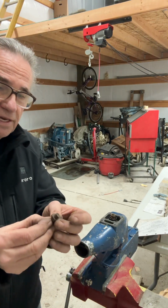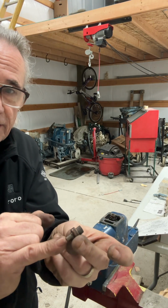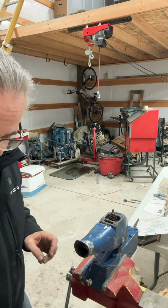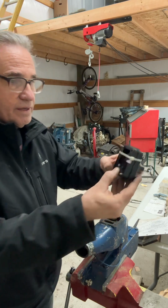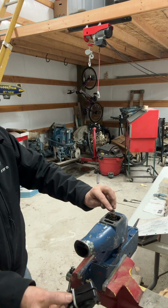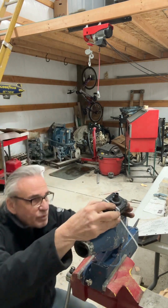The next thing is called your thermostat element, and it has a fat end and a skinny end. The fat end will sit right down inside of that spring. We're then going to take our top assembly, the water passage towards the bottom. We're going to get the narrow part of the thermostat element to ride right inside the center of this block assembly.